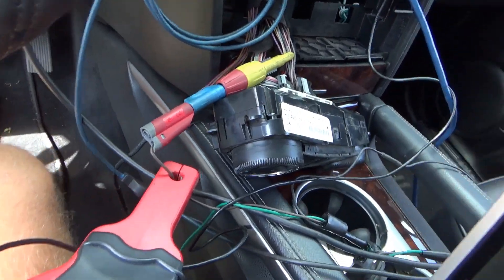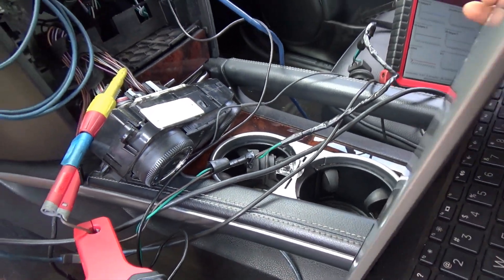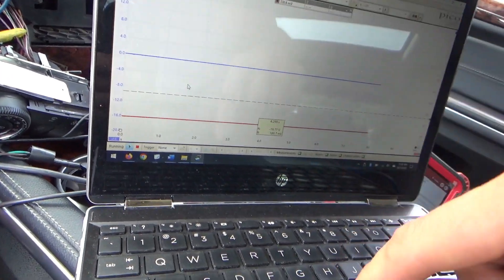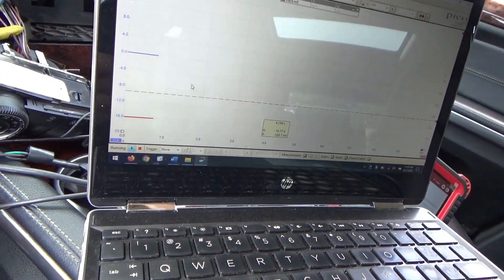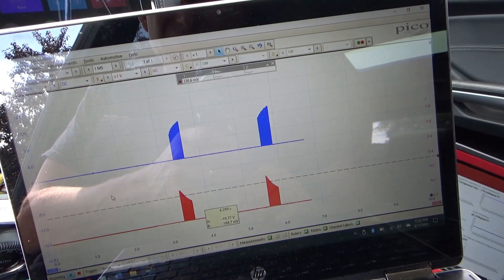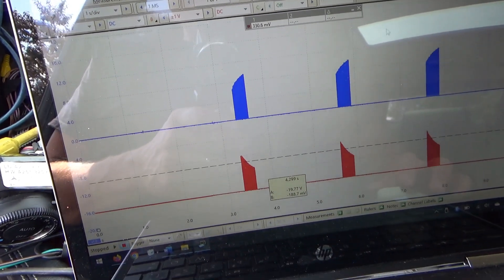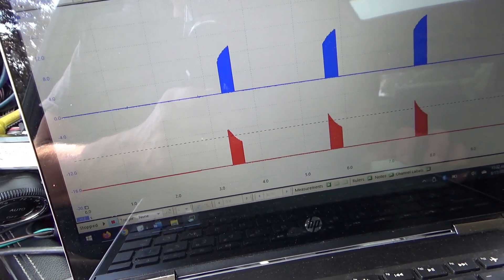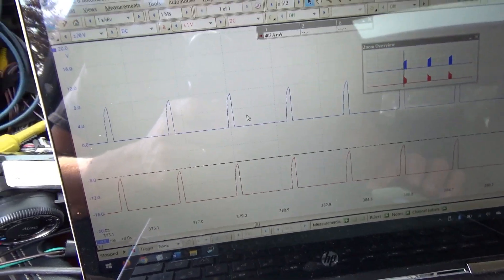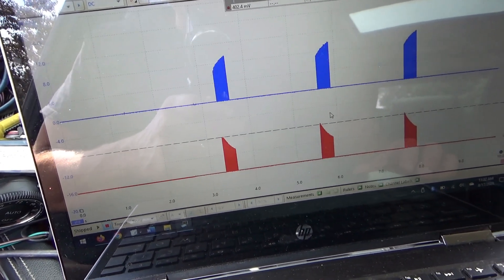Now I have a pair of light bulbs — that's one amp — so I expect the controller won't be able to turn these on, since we know 800 milliamps is the limit. Try one, try two, try three. For the light bulb the initial current goes up toward four amps — that's probably why the controller faults — but the pulses are nice and there's no back voltage.